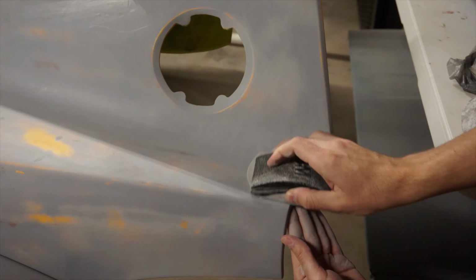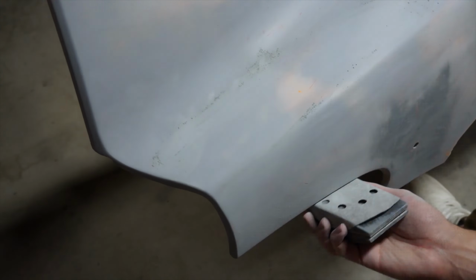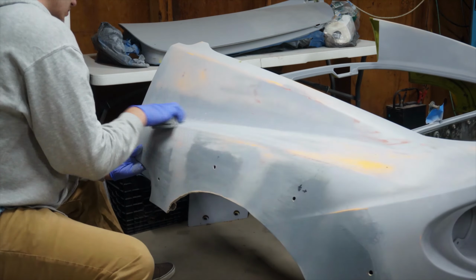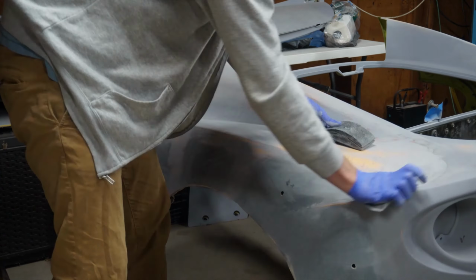Each body panel needs primed and sanded to accept base coat, which is the color, and the clear coat, which is a clear layer of protection on top of the color coat, which gives a glossy surface. What we need is one uniform surface and the primer that covers the entirety of the car so that the paint can properly bond to the surface when we spray the base and clear without any imperfections in the surface or color,